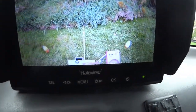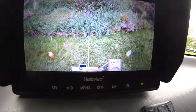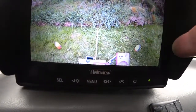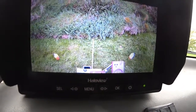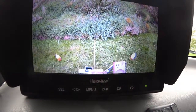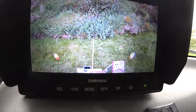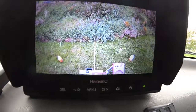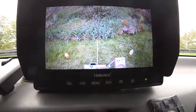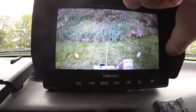And you can see it's still got a really good range. I would have to say that we could go 7 foot in each direction with how much is left here. This looks like 3 foot to me. I think that might be a pretty good measurement. So 4 foot out, you could see as wide as 14 feet across. That's really good. But this represents how wide your RV is in the monitor. And that also lets you know that it's pretty much centered in the camera. I have equal distance on either side here.